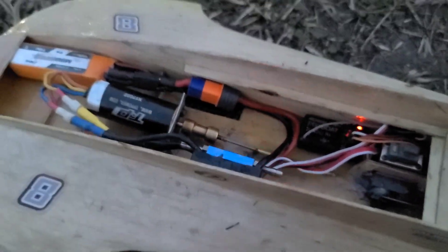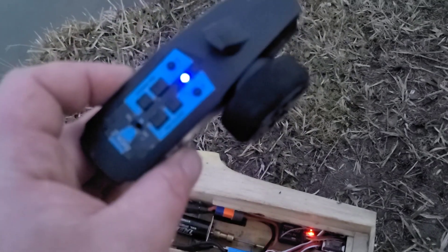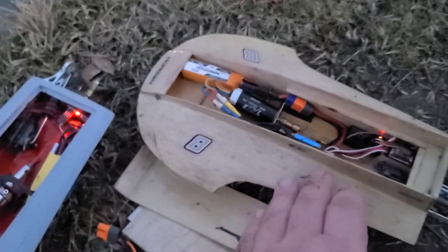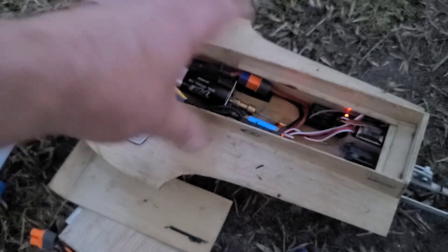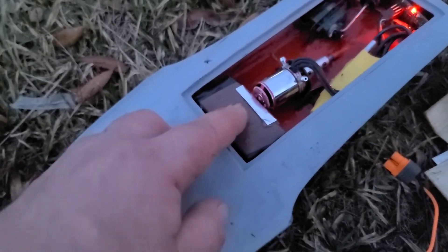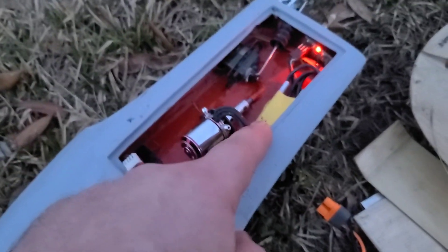I'll have a link in the description — if you guys have little boats 12 to 24 inches, that's a boss ESC. It comes stock in the Blackjack 24. Got the on/off switch on top of the servo with just a generic Pro Boat remote that came with the Miss Geico or something. On 2S it was getting off compared to this 3S boat — probably about five miles an hour faster. This boat weighs 520 grams, this one weighs 320 grams — 200 grams lighter. It handled better with the light battery, the G2 850, versus the Venom 30C 1300. I ran the 850 and it ran better, so I'm going to upgrade the ESC and work on the tuning in the next week or two.